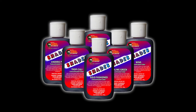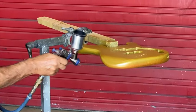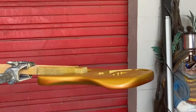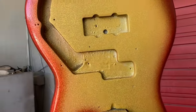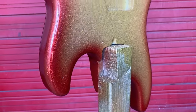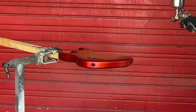It's candy time again with shades. I'm going to put cherry pie candy on to shade the edges — doing a fade or burst on this base. We'll take our time and go slow with the cherry pie candy. Also, we're no longer using intercoat clear; we're using clear now. That's the first and second pass to get color on there. It was a bit too orange, so we added wino shades to the mix and went over it again with wino to darken it down for more punch and contrast.